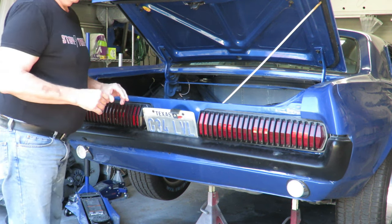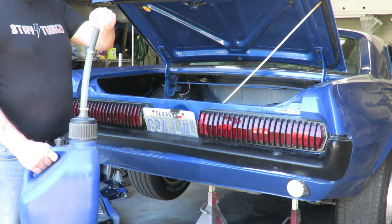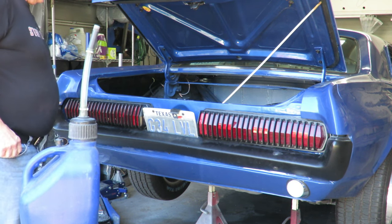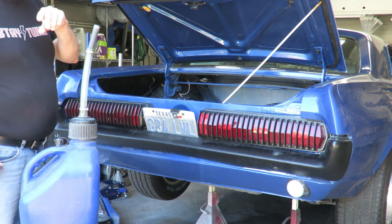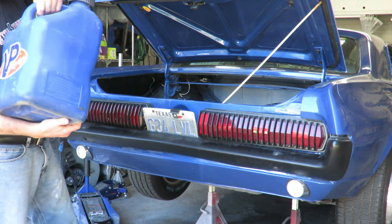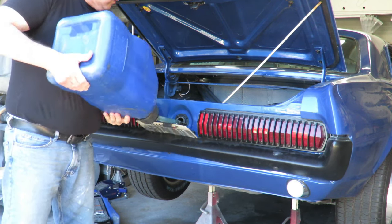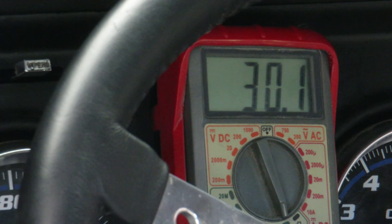Here's the game plan: we're going to put gas back in the car while I film the meter. Tank empty should be 73 to 75. As gas is added, the reading should drop down toward 10 when full. The car being jacked up at an odd angle may affect it a little. I put four gallons in and it dropped from 73 down to 30. Going to keep adding more — about another five gallons — and watch the meter. Things are going our way finally.